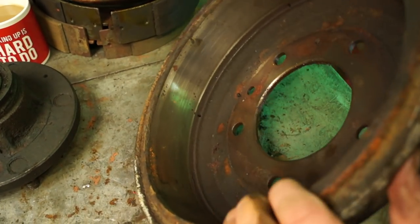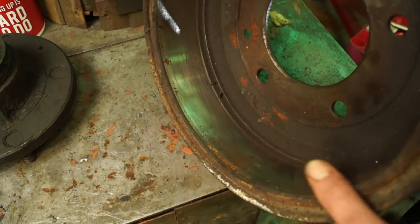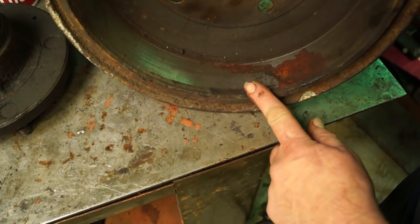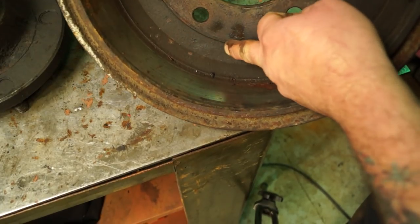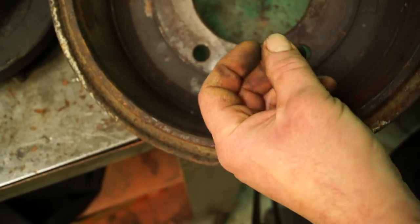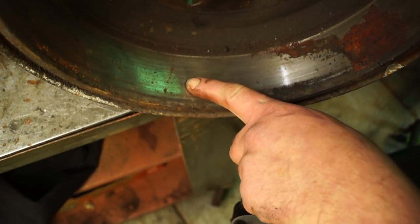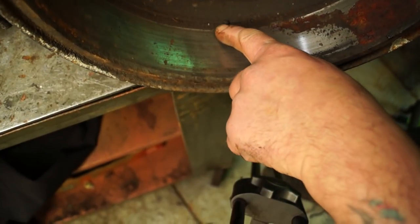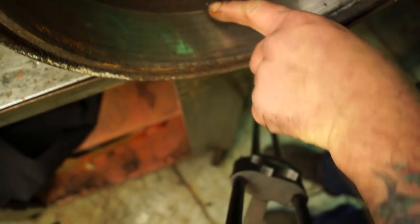The other drum, which had a hub seal leak, is not too bad — you can see the working surface there is all right. What I feel for is a convex feeling to see if it's worn at the back end. If it's convex then basically they'll need skimming or replacing. You can see here the oil from the hub leak — it's not excessive, however the leak needs to be sorted. I'm looking to see if it's convex and worn on the edges and at the back end, which it is. It has quite a raised edge, which tells me the drum has already been past its best — the more convexness you have, the longer the brakes are going to take to bed in.